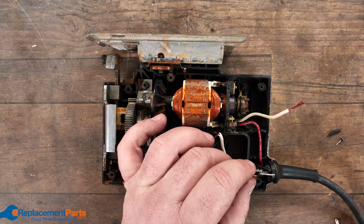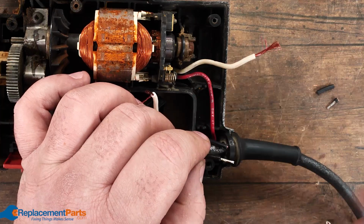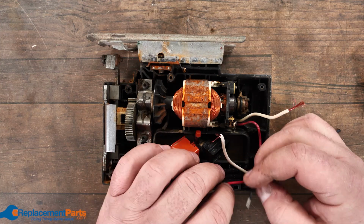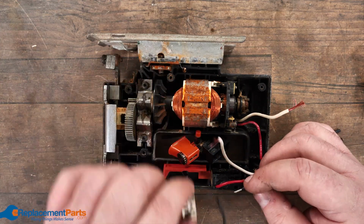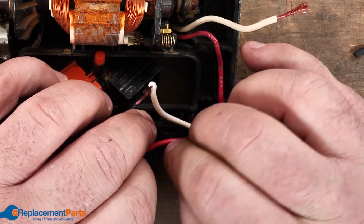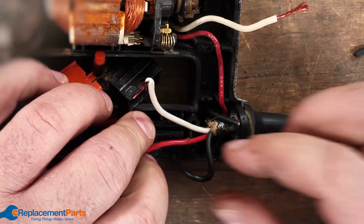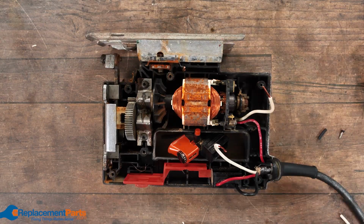What we do is just cut that down to the proper length to fit the switch. Cut it. We'll take the black, and just as you've seen with our taking apart the switch, we'll push that right inside until it locks, and then we'll double check it, make sure it's solid. For the white wire, we got a couple options. We're going to take a different approach here. Just use a little bit of heat shrink.